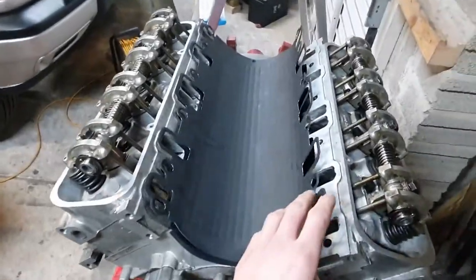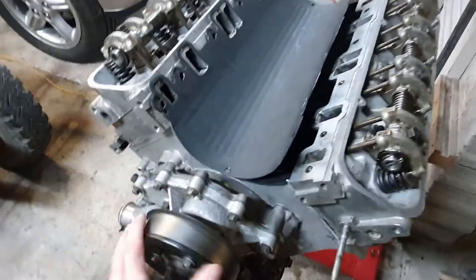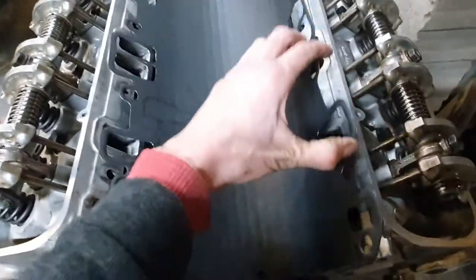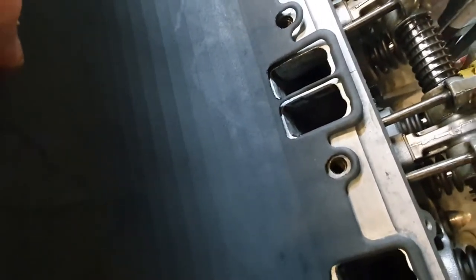With all the rockers done I'm really close to getting this thing together. I think I've done the last of the fettling work — the messing about I've had to do because all the heads and the block were skimmed. Because this is so much closer, this gasket doesn't fit too well. So to exaggerate the situation, when you place the gasket on it, it sort of lines up a little bit like that — do you see? So what I've done is I've ground away at the bottom of the gasket so it doesn't offer a restriction in the port.